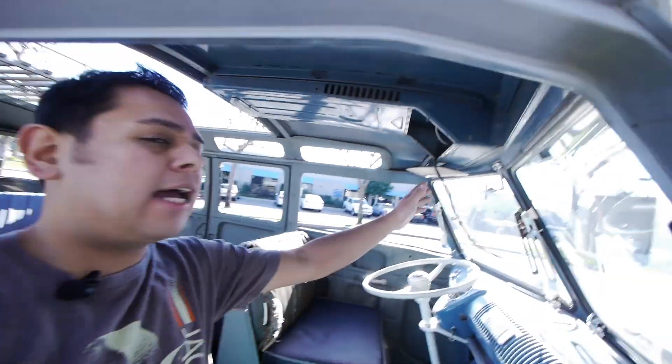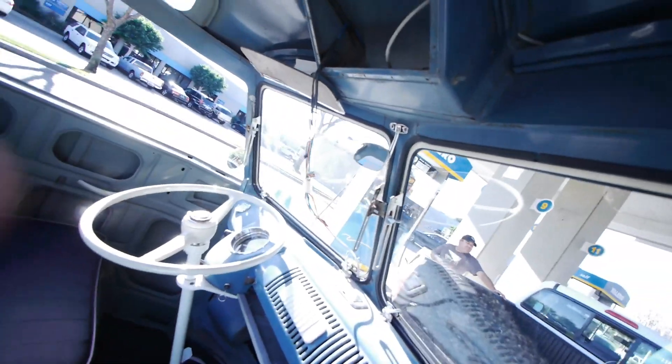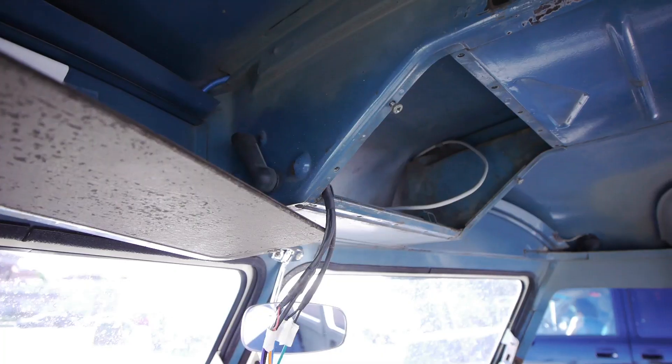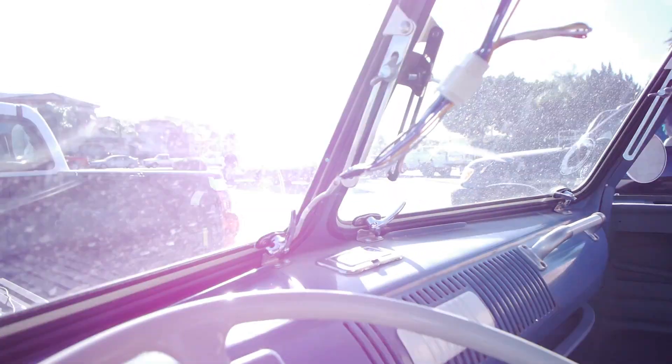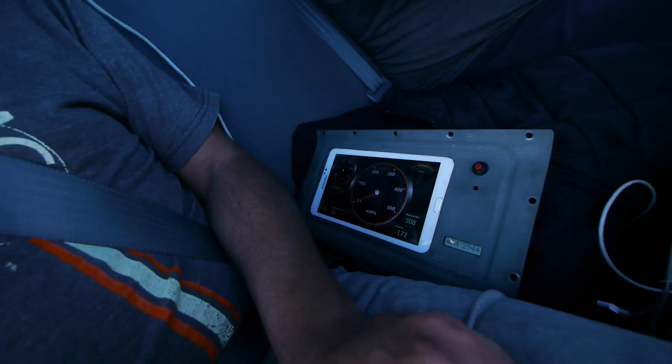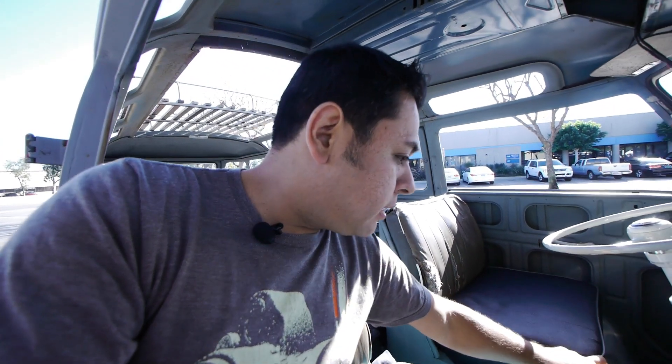What we're doing is I have put a cable in here for my instrumentation, and that is going all the way to inside the cab of our tow truck. That's going to allow me to keep an eye on the parameters of the motor — my motor temperature, my controller temperature, how much energy is going into the pack and at what rate, the state of my battery pack, my RPMs, everything. I'm going to be keeping an eye on this because we want to make sure that we do it in a safe way, and that's today's test.